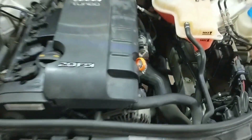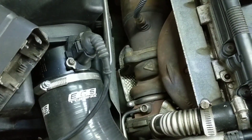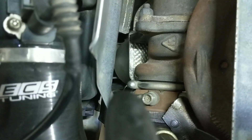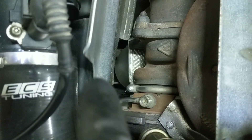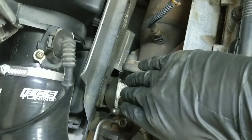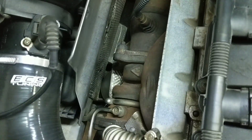Next up, it's time to take off the top bolt from each of the engine mounts. I like to start with the driver's side because it's quite simple — it's right out here in the open, and you're going to be taking off that nut right there. You can use your 13mm stubby wrench to easily get in here, otherwise you can still fit in a wrench and a socket — you just have to bend this hose a little bit to the side. Coming to the passenger side, which is the infamously fun one, you'll be over here under the turbo. You'll probably want to bend up this heat shield a little bit to give your stubby wrench a larger swing path. I usually just stick my thumb or finger in it with my hand backwards, doing basically this type of movement, and that's the most effective way I've found to get clearance enough to get the nut on or off.